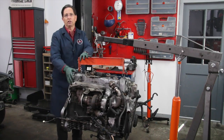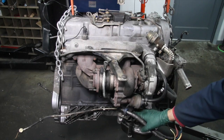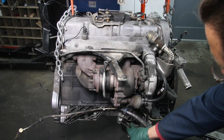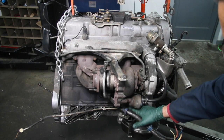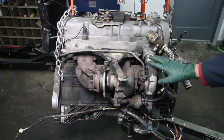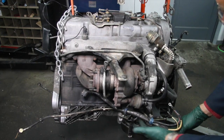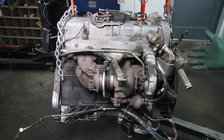There is very little difference on the right side — only a couple things you're going to have to change. The first is the motor mount; that's probably the most important. The W126 motor mounts are different — this arm you see right here and the position of the shock mount. The actual shock is the same, though the tower may be different depending on the model. You'll need W123 turbo motor mounts when you put the W126 300SD engine in. You'll also see some differences in the wiring harness, but that's a real easy swap — you'll just use your older wire harness for the alternator and starter wiring.